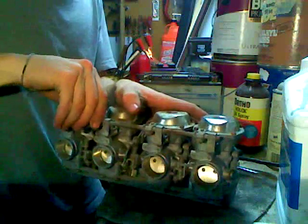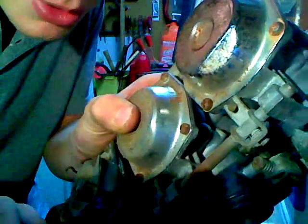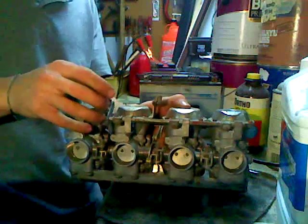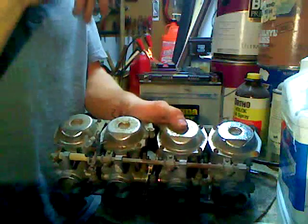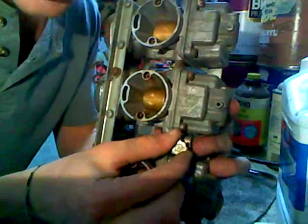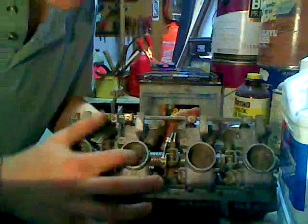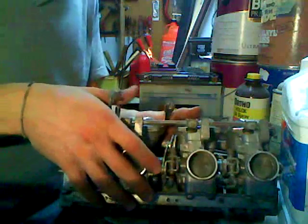Also, we have the choke here — you move it up, it's right here. See how that moves up and down? That's adjusted by the handle controls on your handlebar. Also over here we have the idle speed screw. If you tighten this in or tighten it out, it'll slightly open or slightly shut these throttle plates, which will increase or decrease your idle speed. That's important.